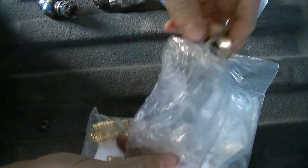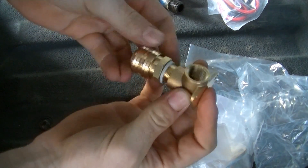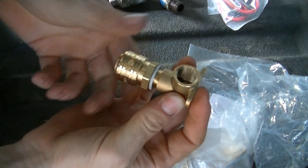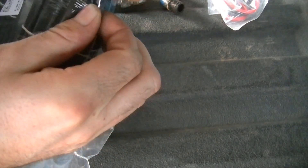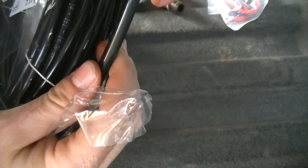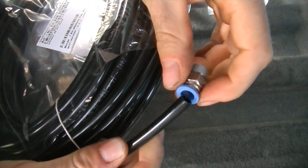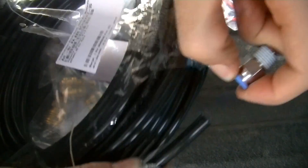Now I want to install a quick connector air terminal in the truck bed, so I ordered a few parts. This quick coupling will be installed in the bed. It consists of a brass coupling in a 90-degree angle with three holes to screw it on, and all threads are 3/8 inch. To connect this coupling to the air tank on the passenger side, I use a polyamide hose that is 8 millimeters in outer diameter and rated for operating pressures up to 275 psi. The maximum pressure from my compressor is 200 psi, so it's fine.